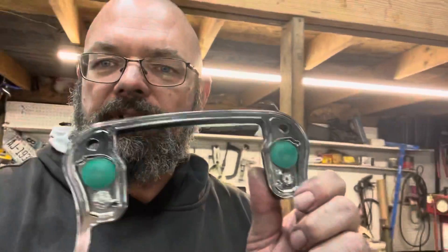On this job, it wasn't necessarily required for me to replace those seals, but they came with the kit, so I might as well — I've got it open. The ones in here could very well be the original pieces. They do feel a little firmer than the new ones in the package, so while I've got it open I'm just going to replace them. The customer already paid for the gasket kit so they're his seals, and it takes me almost no time to swap them out. Just grab them and pull them out, and when you go to put the new ones in, just make sure there's a tiny bit of oil on the little pin on the backside so that it slides in and pops into place.